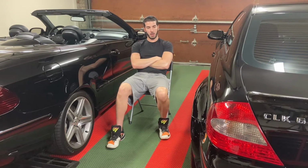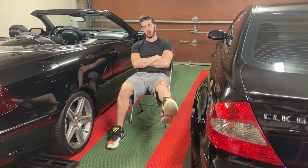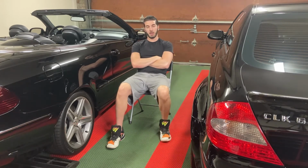The one thing I did notice on the actual Evo is that the rear flare for the bumper is actually molded in. The reason they did that is because that rear bumper, when you cut it, is missing one of the mounting points. So what I ended up doing was I kept it separate. I had a custom metal bracket integrated into the bumper, so it's still removable. I feel like that way, if I bump into anything or one of the flares cracks, then it looks good.